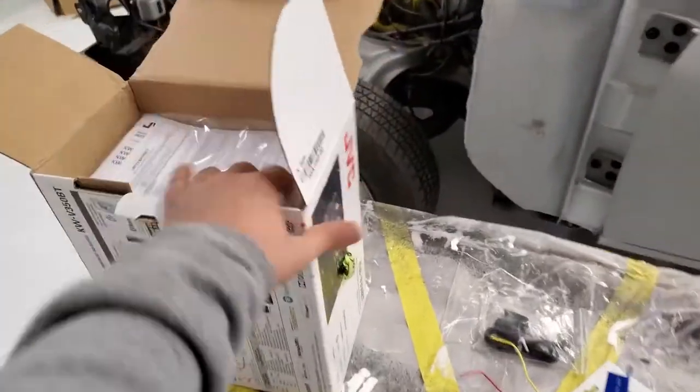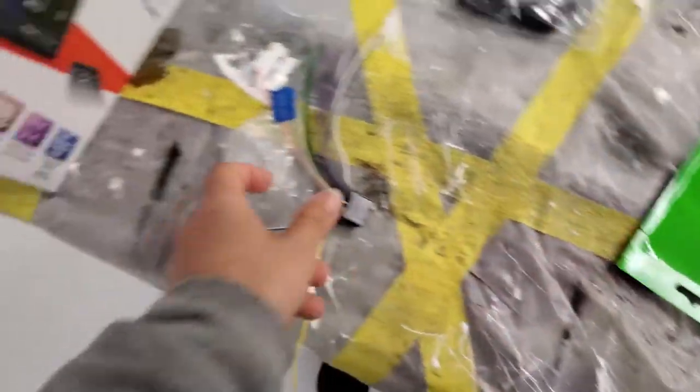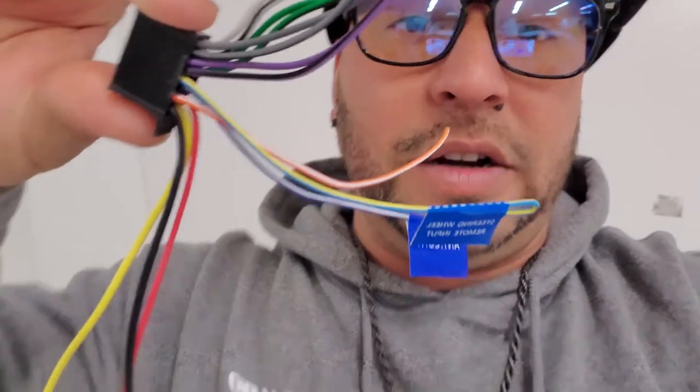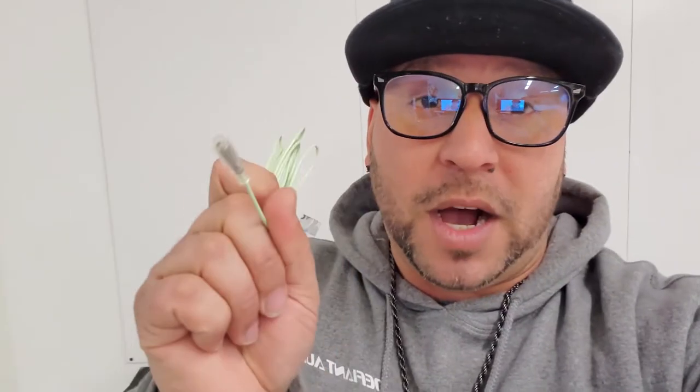Back to the video. We've unpacked our double-DIN DVD player to bring out the wire harness. When we first look at a wire harness, we want to identify the lines we're going to be working with. The parking brake wire is this light green wire here, which is very typical for a parking brake wire. In this case, it was not in our main harness — it connects directly into the radio on a small jack in the back and is separate from the harness. But that does not change how we wire in our device.